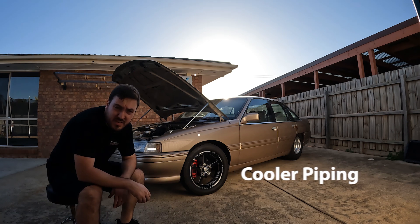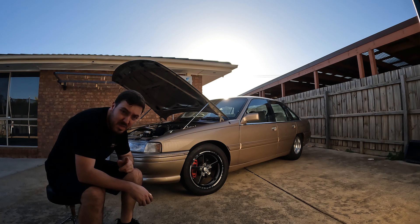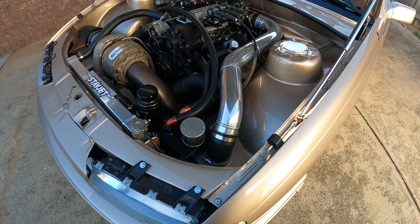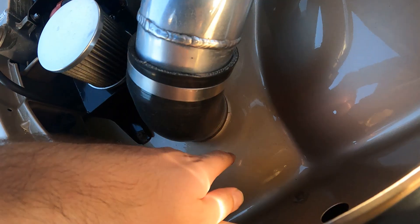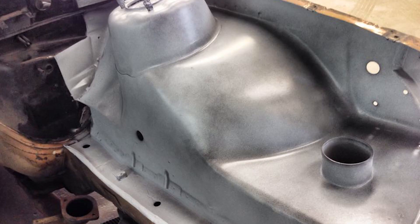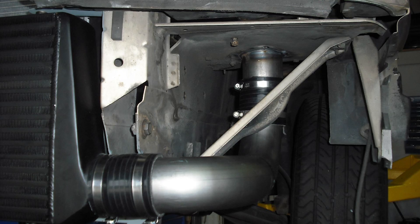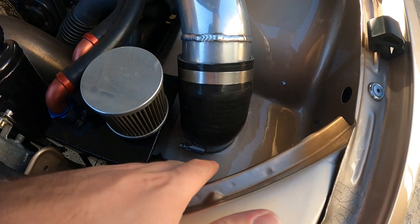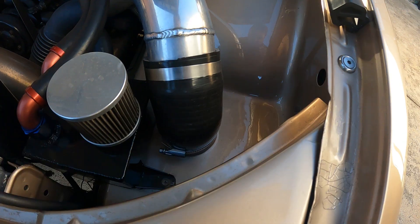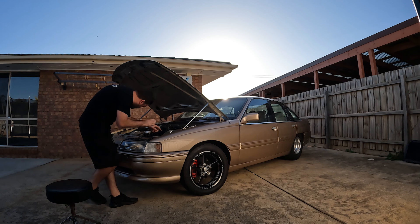So that's clearance. Now we're going to go over intercooler piping. If you're cutting any holes through any body panels, this is what you need to do: if you're going to cut through any of the engine bay panels, you're going to need to replace it with double metal. In my case, I've actually welded a tube - a three-inch pipe that goes to this panel and straight down. If you do decide to cut a hole and replace it with double metal, you can leave it open - it just needs to be double metal with a pinch weld or some sort of seal around it. No sharp edges, no exposed sharp metal.